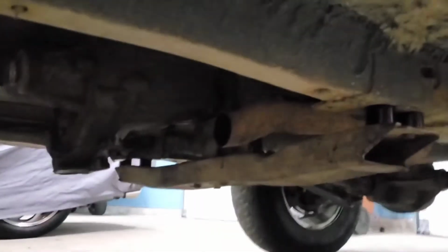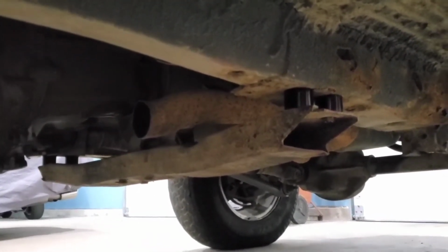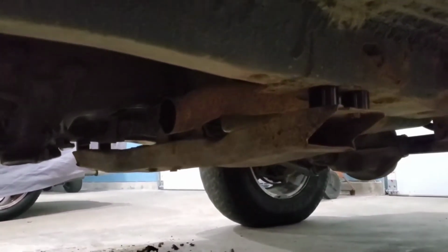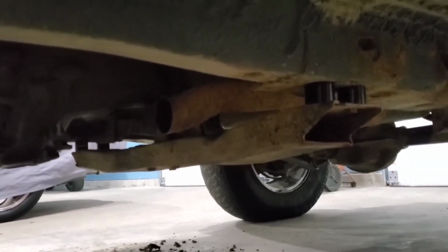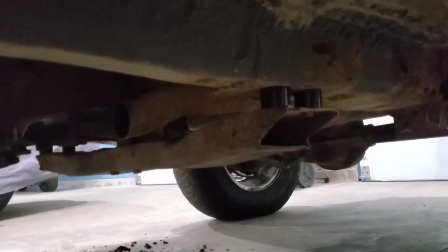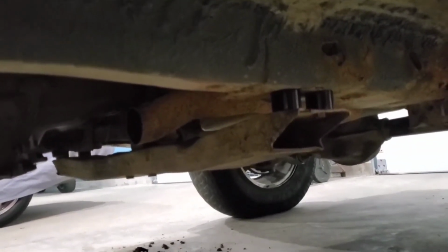going to put an exhaust system on it, because right now, the exhaust terminates under the passenger side floorboard. So if you look up under there, you can see the tailpipe just terminates there. And normally I wouldn't care too much about the exhaust note being too loud and obnoxious. But again, since I'm trying to drive this thing on the street, I want to knock the noise down just a little bit. You can also see those black pucks there. That's the 1-inch transfer case drop. Wasn't too hard to do, but 3 of the 4 bolts came out. The 4th one gave us a little trouble.